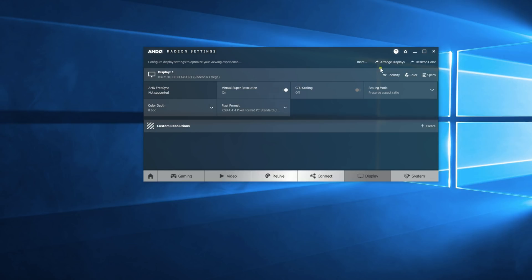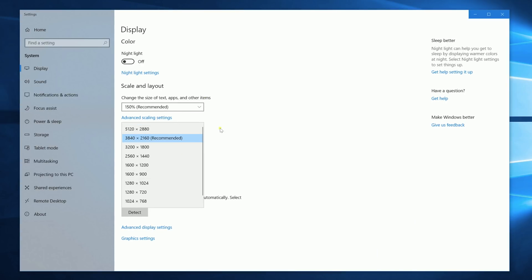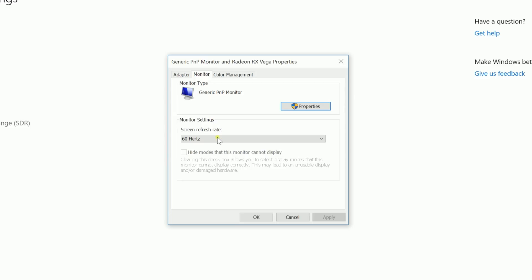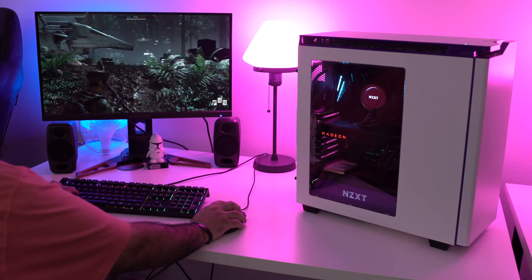Your new video card is in there. You'll either see the AMD Catalyst Control Panel or the NVIDIA Control Panel — click on that, and in here is where you can do all your different settings. You can change your resolution and change the refresh rate. Remember, the refresh rate is only going to match the monitor that you have on your system. So if you have a 60 Hz monitor, you can only set it to 60 Hz — you're not going to be able to set a 60 Hz monitor at 144. But if you do have a 144 Hz or 120 Hz monitor, make sure you go into the control panel and set it to match your video card. After that, you're good to go — just jump in, play your games, and everything should be running absolutely great.